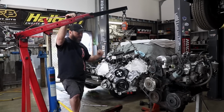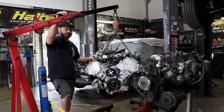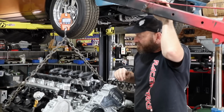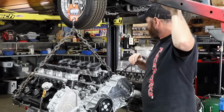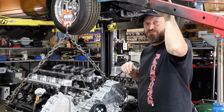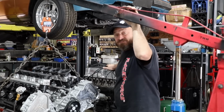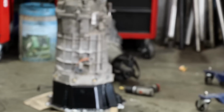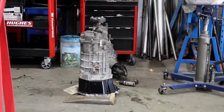And here we've got a 5.6 litre all aluminium V8. 5.6 litre. Did I say that already? Yep. 180 kilogram engine. So that's 181 with a starter motor. With the flywheel and clutch and everything, it was 199. So it's pretty close. And a 66 kilogram TR6060. Yeah, the 6060 is a fatty. It is quite heavy. And as you can see, it's seriously a lot larger than that little gearbox.